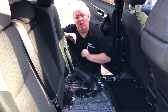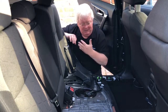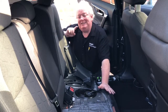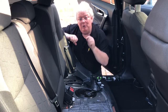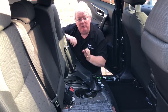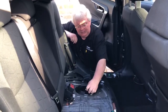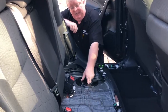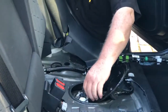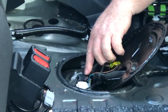What's different and why do you need to know about it? They're located in a fuel tank just like always. So like on this RAV4, you pull the bench seat out and go to work when you've got a no-start and no fuel delivery. But what's different is how they work and how you diagnose them. So watch these tech tips and learn a brand new kind of fuel pump. I'm going to take this pump assembly cover off and show you — we've got a little clump of wiring here, two connectors. One is for the sending unit, this one over here for the pump.